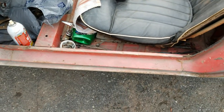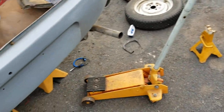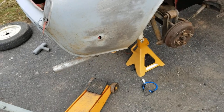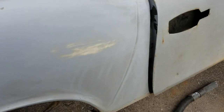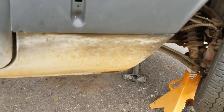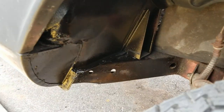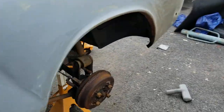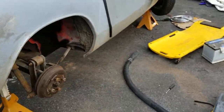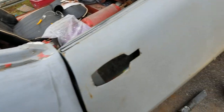I got all this sanded down here, got this sanded, got up here sanded, got all back here sanded down. A lot of this stuff is just pure Bondo — pretty much just Bondo. I got that sanded down for the most part. I didn't go all the way to the Bondo in a lot of this area. I've got undercoating sprayed in this little corner here. I ran out of undercoating for this side, but I have another can that's warming up in the sink right now with hot water since it's too cold and it doesn't really want to come out of the bottle.